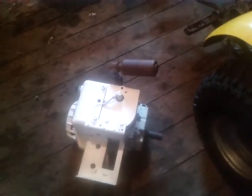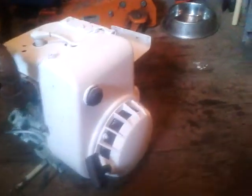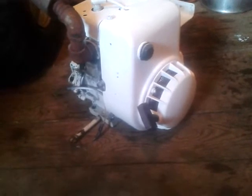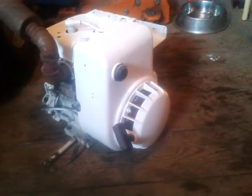I don't really have much more to do over here today. When I go to paint the rest of the engine, I'll make a video on that. This is a Tecumseh 8 horsepower. It works good — I had it going. But something's wrong with the governor; it was just revving way too high.